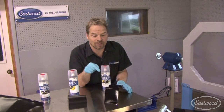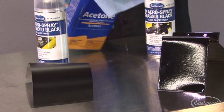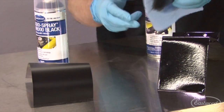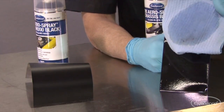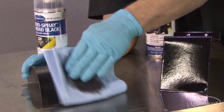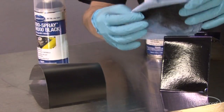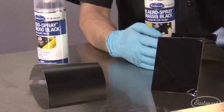There's one more important thing we've got to check. We're going to give this paint the same test we did on the conventional rattle can paint using acetone. It's the same rag. Nothing comes up — nothing comes up. It's clean. It doesn't affect the paint, it doesn't move the paint. This is a true catalyzed paint.